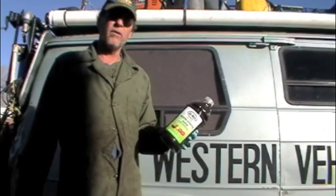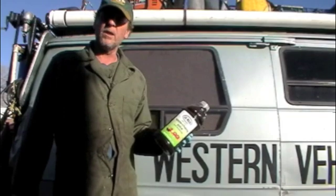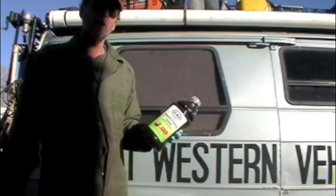The rest of it is pure enough to run in the engine. If you don't filter down to 1 micron you'll probably go through more fuel filters, but your fuel filters aren't going to plug up too quickly using that simplified process. This sample of waste oil blend diesel fuel has sat for a day, only passed through a few screens, and been settled and separated at three stages. As you can see, at the bottom of the container there is no sediment whatsoever — so we can say that simplified filtering can work.